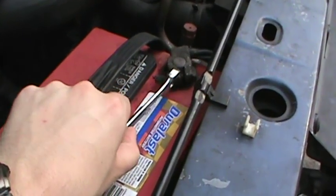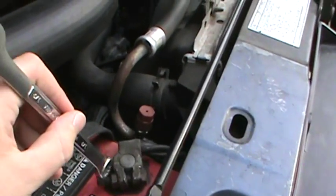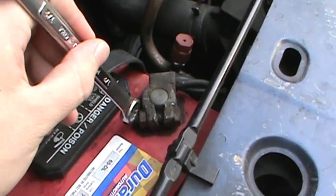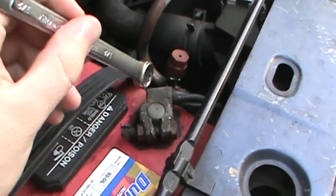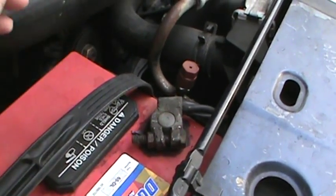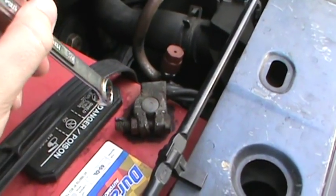And one thing that you should always do prior to replacing anything electrical on your vehicle, you must disconnect the negative black lead or the minus battery terminal from your car battery, because if you do not disconnect this terminal, there could be a ground out fire or something really bad could happen, and we do not want your vehicle to be burned to the ground or something very serious destroyed in the electrical system, example the computer or anything of that nature.